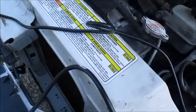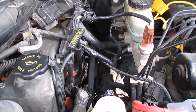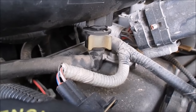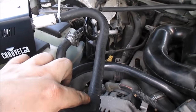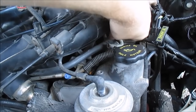It looked like it was coming out right here. It's ready — I'm going to give it a shot again and see if I can spot it. It's clear as day coming out right here. See that? I'm trying to see if I see it anywhere else. It's coming out right there — looks like that fitting right there. I actually moved it around a bit and now I'm going in on this side, smoking it here with my brake booster back on. To me, it looked like it was leaking really bad from just whatever this part is right here.